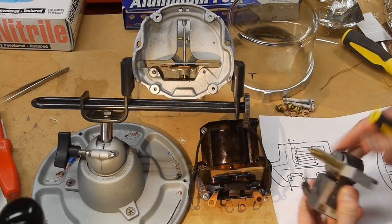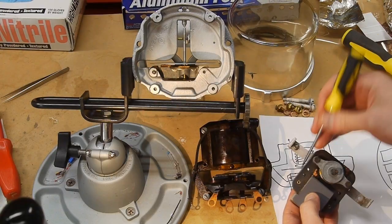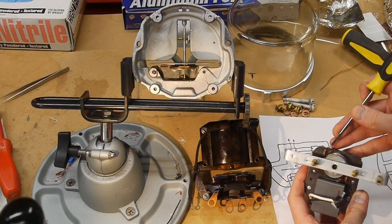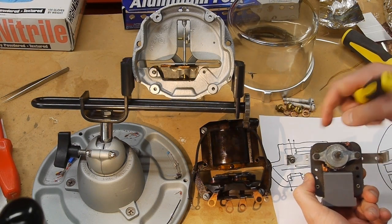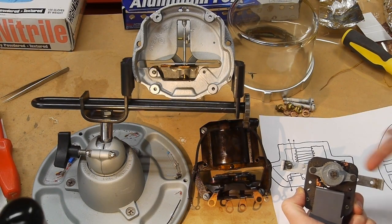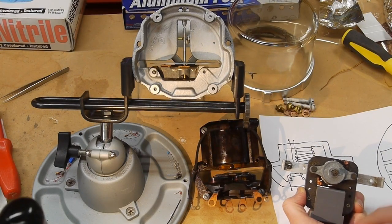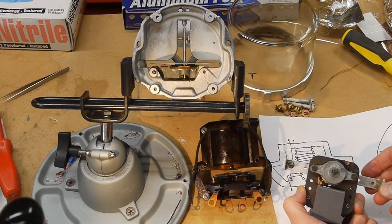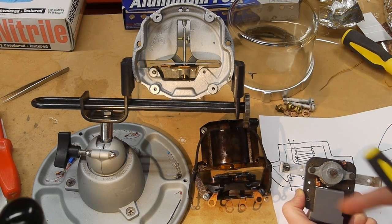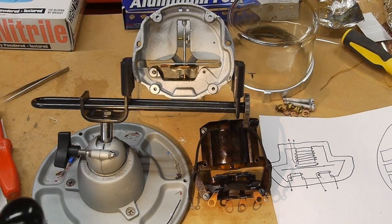This same principle is used in what are known as shaded pole motors. Here's a cheap motor that came out of a window fan. It's got iron to channel the magnetics from the coil into the rotor, but it also has these copper wires that are all just connected to each other - not connected to anything except themselves, and isolated from each other. These loops of wire introduce a 90-degree phase shift that helps get the motor started. We only need that phase shift to get the rotor spinning; once it's spinning in one direction, the geometry of the motor takes over and produces torque. The term 'shaded pole' just means we've added a loop of wire to cause this phase shift.